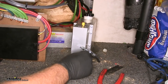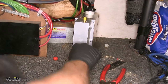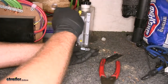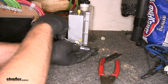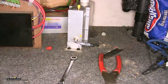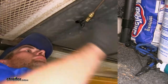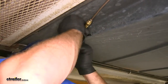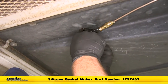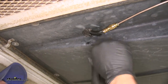The last connection we'll make here is to the master cylinder — do this quickly because a little fluid will come out once you unscrew it. Get it threaded in, then put a little wire loom around the top edge to protect it. Replace the circle we cut out with the hole saw and run black silicone sealant around the edge to prevent moisture from coming up into the bottom of the camper.